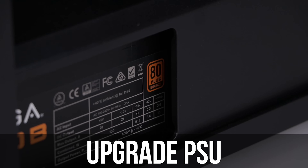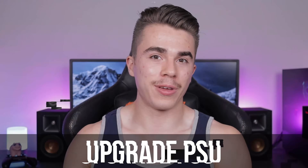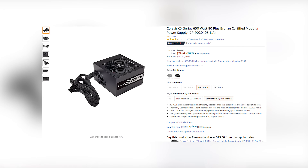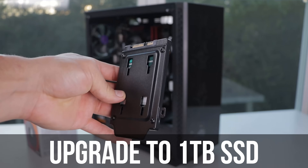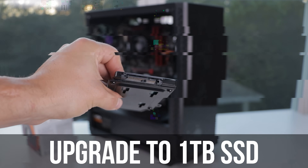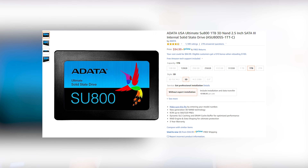With the remaining $20 to $25 from the $50 budget, I'd spend that on a higher quality 600-watt power supply that's 80 Plus Gold, or if you get a really good deal, 80 Plus Platinum, so you can have a longer-lasting PSU with a five or seven year warranty. And for an extra $100 total, include those previous upgrades but use the remaining $50 on a one terabyte SSD. That way you'll have no worries about storage for whatever games you're loading for years to come — one terabyte should be enough for games, videos, documents, school stuff — you name it.